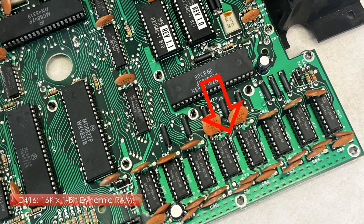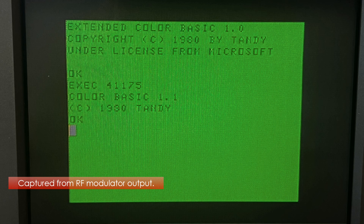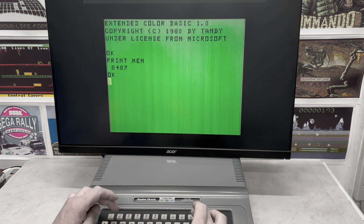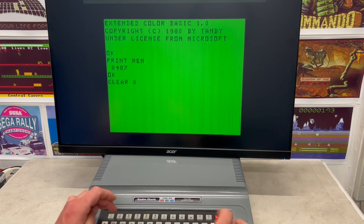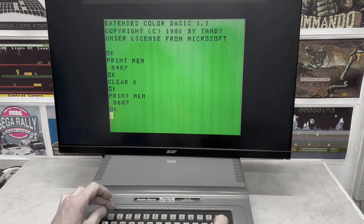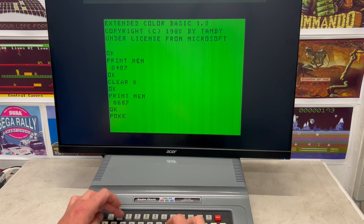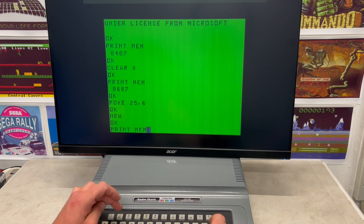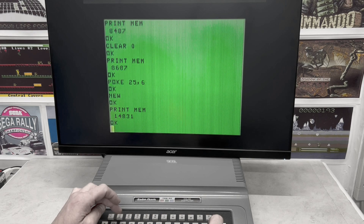During our assessment of the motherboard, we identified this TRS-80 had 16K and was running Microsoft's Extended Colour Basic version 1.1. Having typed PRINT MEM to check available memory, we've only got around 8K. This is because the Extended Colour Basic ROM assigns 200 bytes to provide initialisation for printers and keyboard devices. Using the CLEAR 0 command, we can allocate these 200 bytes back into available memory. In addition, we can release 4 pages of graphical memory, reallocate the beginning of basic and disk drive routines, which releases just over 14K which we can now use to play some games.